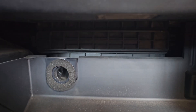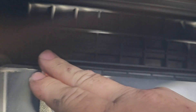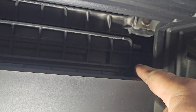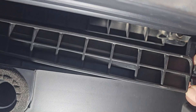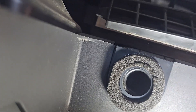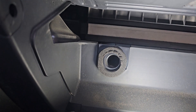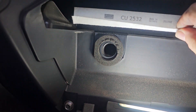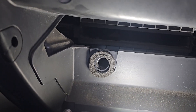Then we have a look up here — it's got two little things here, squeeze them together. That end gets located in there, and we just pull the air filter out, taking note of the airflow direction.